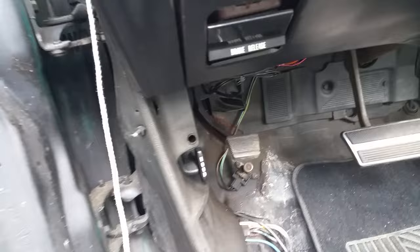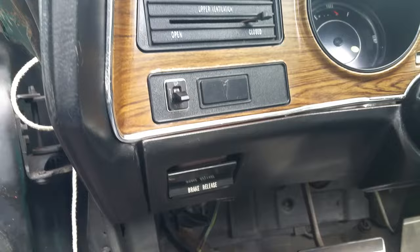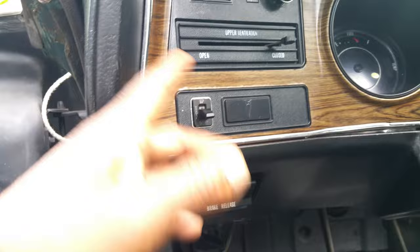If the fuse is good, you move on to your switch on your dash. Sometimes your contacts inside your switch are bad and you can just take it apart, sand down the contacts, and it probably will work. It's real simple — just contacts. So if you sand them down and clean them up, it probably works because it's probably got residue and old stuff from just sitting around. So you can try that out.